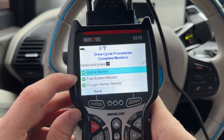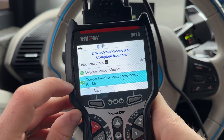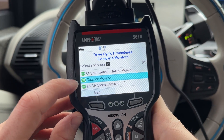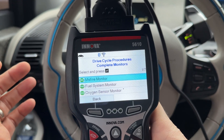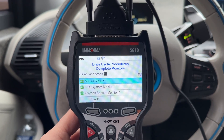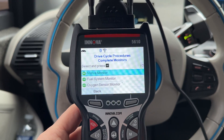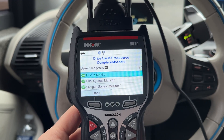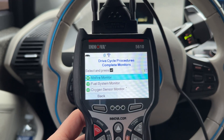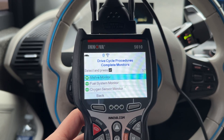We have all the systems being checked on this BMW i3: the misfire monitor, fuel system monitor, oxygen sensor, comprehensive component monitor, oxygen sensor heater monitor, catalytic converter, and EVAP system. If you have a more ICE-oriented car with a combustion engine, you'll most likely see a couple of other ones. These are all the systems that have to be ready in order for you to pass emissions. If you don't have one of these scanners, you can get a much cheaper scanner that will do basically the same thing for the IM readiness check — I'll link some in the description.